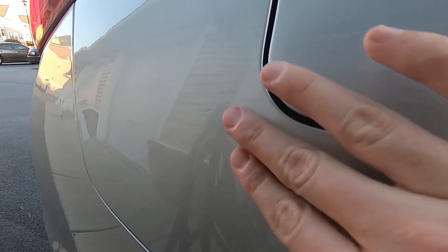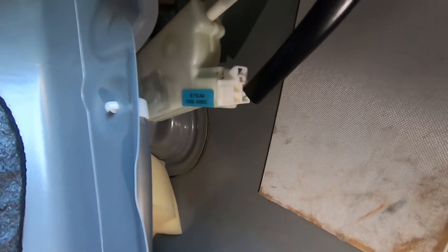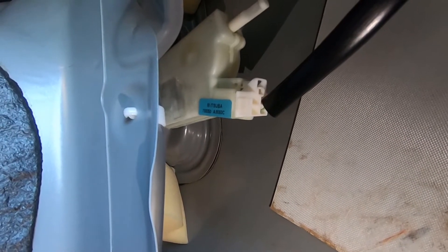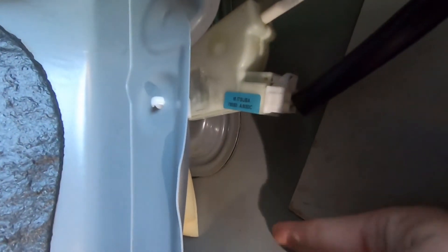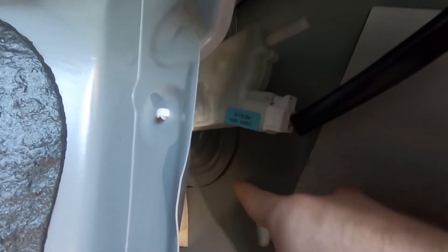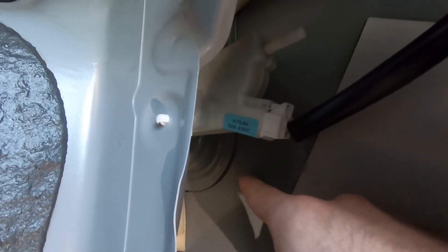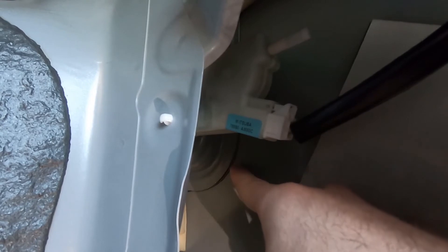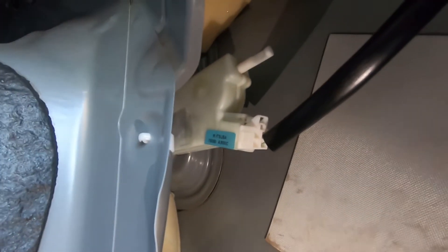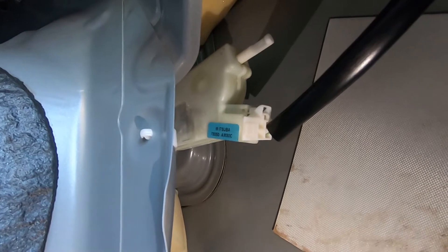The reason there's still a little bit of a dent showing is that right where the dent is located there is a double thickness of steel. You have the outer body skin here and you also have the skin to the gas door filler that is seam-sealed and/or welded to the outer shell. I can pull the outer shell all I want but it's not going to move the inner skin that's connected to it. I could disconnect all this stuff and try to get back here, but it's not worth it because I'm putting a panel over top of it anyway, so you're never going to see it.